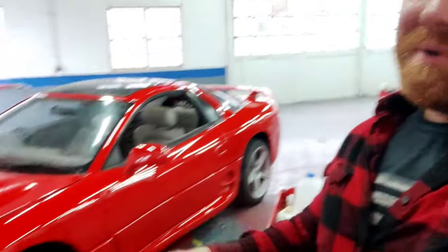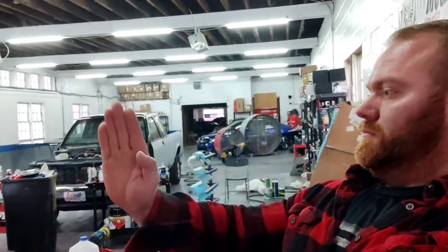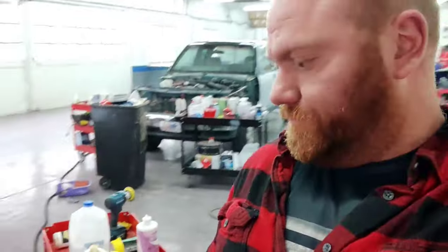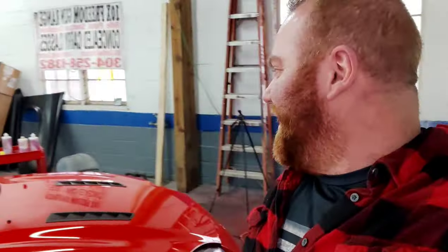But at three coats of paint, I knew I had not burned through at all. I had plenty of material, especially single stage being a little thicker — plenty of material to wet sand and buff. I'm not going to say that is an invisible repair; you can still see it if you're right up on it, like six inches away from the panel. But just walking past it a couple feet away, I cannot notice it. So for all you experts out there that say I don't know what I'm doing — there you have it. I do know what I'm doing. I know exactly how to fix every single screw-up I have.